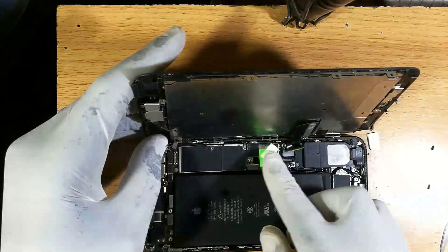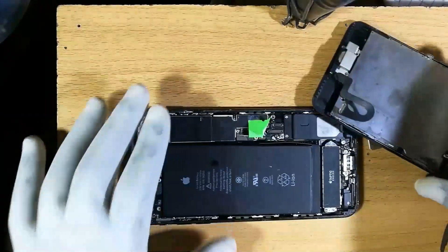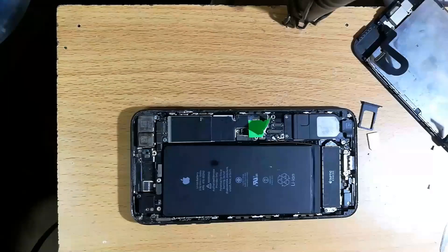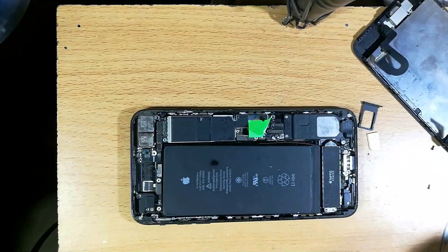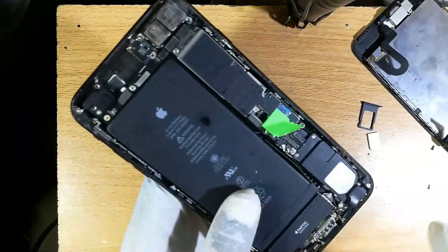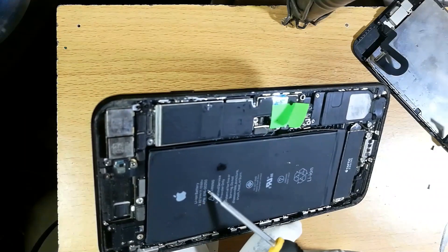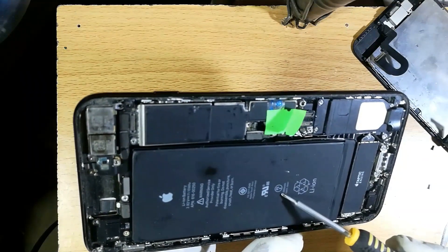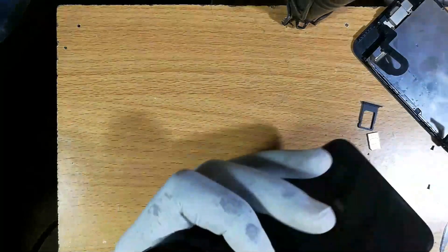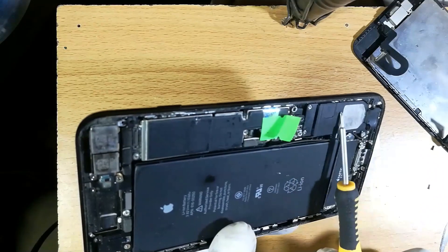There's actually another cable underneath — reach out for that and remove it too. Assuming you had to replace your screen, this is what you would have to do up to this point; plugging those things back in is fairly straightforward. Now let me point out key components: this is the battery — a 2,900 mAh battery. Those are the dual rear camera modules, that's the charging port and its support bracket, and that's the loudspeaker.